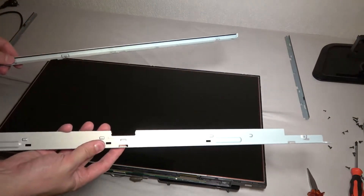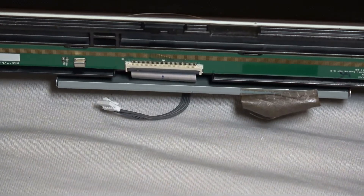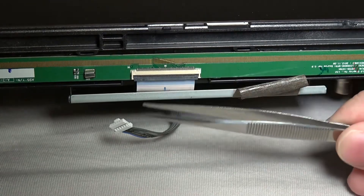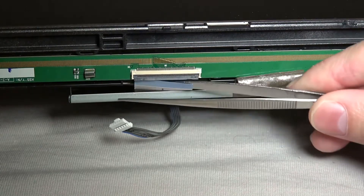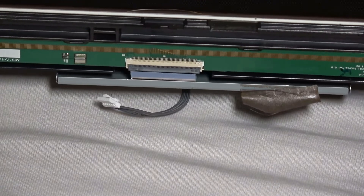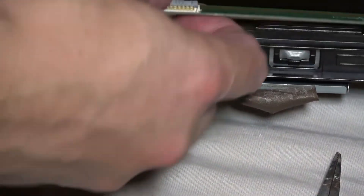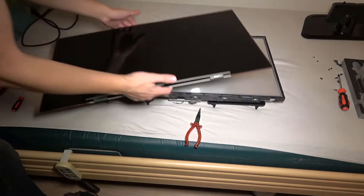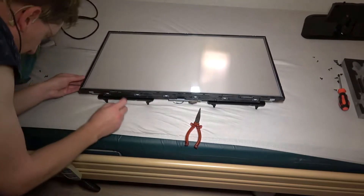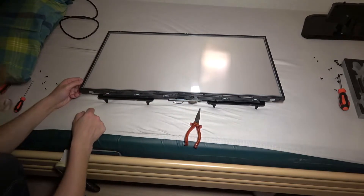Here are the hooks as you can see, on this side and the side. We have the frame removed. There are still more screws around that need to be removed. Here is a ribbon cable. It's very important to note the exact orientation — the wide side is at the bottom, the narrow side at the top. I'm going to remove it carefully. You can apply gentle pressure with a pin set so you don't damage the cable.